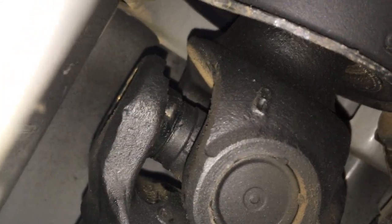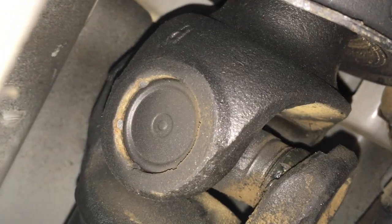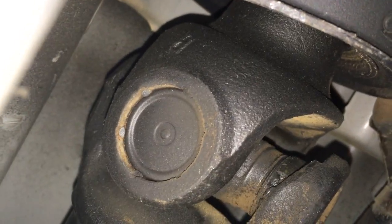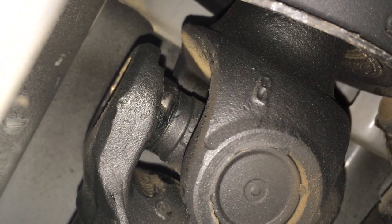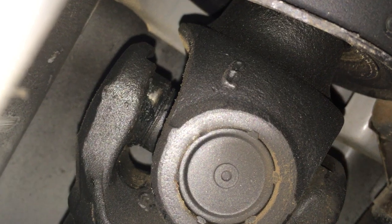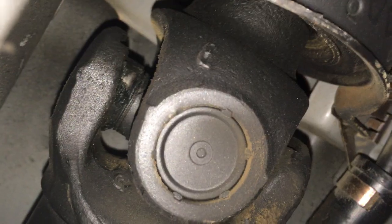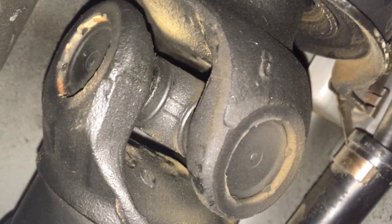You can even see a little tear right up there in the top corner on the u-joint. If I just rotate this quickly forward and back, just listen to this sound — this is what will be causing your rumble strip sound. It sort of sounds like a bad wheel bearing, although those usually sound more like a humming. You can actually see the play if you look at the bottom.